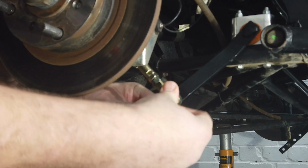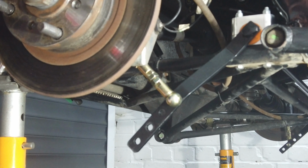So what I've been told is often the 2nd hole from the roll bar is not often used, and if anything you would opt for the nearest hole to the roll bar for the stiffest setting, and this is the setting you would use on a dry track, and more often than not this is where the roll bar would be set to. There is, however, a further setting which can be used for wet tracks, and that's to remove the effect of the anti-roll bar altogether.